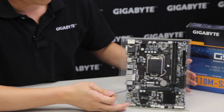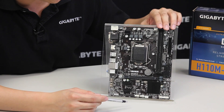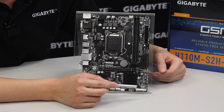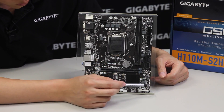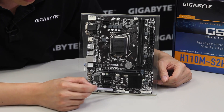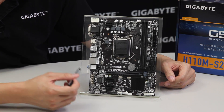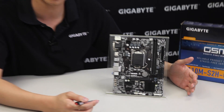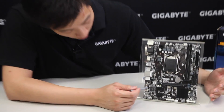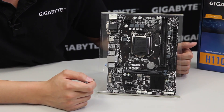For the motherboard, we talked about some of the features earlier, but so you can see the placement locations and what it actually has on it: it has two DIMM slots for DDR4, the 24-pin power connector, a USB 3.0 front panel connector, four SATA 3s which allow for six gigabits per second throughput, front panel headers, two USB front panel headers, a TPM connector, as well as audio and COM ports. Gigabyte introduces technologies from our high-end boards onto our budget and mainstream boards, such as the audio noise guard and path lighting. This board has the noise guard and path lighting along with better audio capacitors.